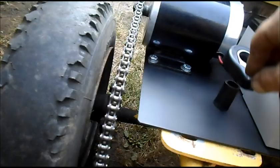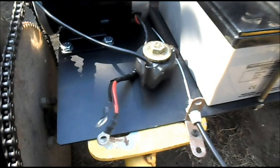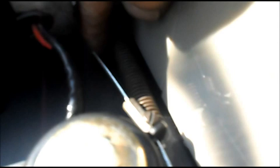Put the throttle over it, put the bolt down through it, and put our lock nut underneath. This is pretty much how our thumb throttle setup is going to be. We've got our thumb throttle mounted on a post, bolted down good and tight. We've got our accelerator cable bracket mounted down and we've got a return spring.